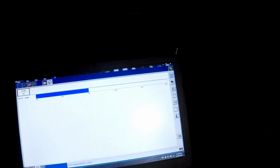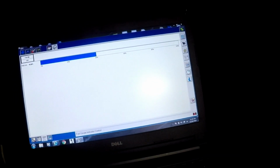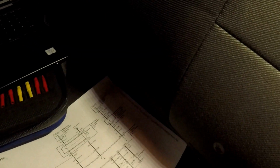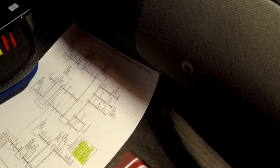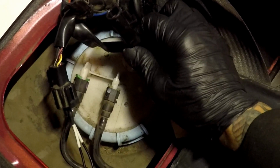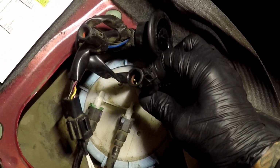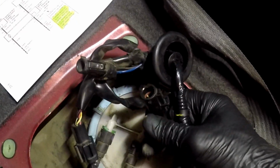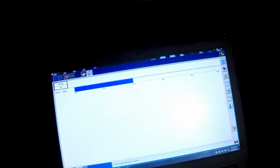It verifies that the cluster itself, the stepper motor inside the cluster, is good, and we have an open fuel level sensor. So this pump is going to be getting pulled out. We're going to put a new fuel level sensor on there and call it a day. All right, thanks for watching, guys.